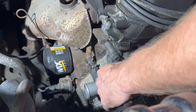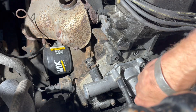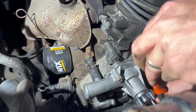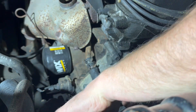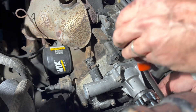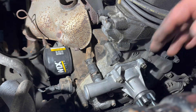Water pump time — just like that, hopefully. Now we need a ratchet. This is aluminum on aluminum with aluminum going into cast iron, so your torque spec is not crazy. If I had to guess I would say it's not more than like 25 to 30 foot-pounds tops, and it's probably less than that. Go around twice, because when you snug stuff sometimes the others aren't quite tight anymore. Tight enough. Do yourself a favor — make sure you put these on in a way that you can actually get to them next time if you have to.